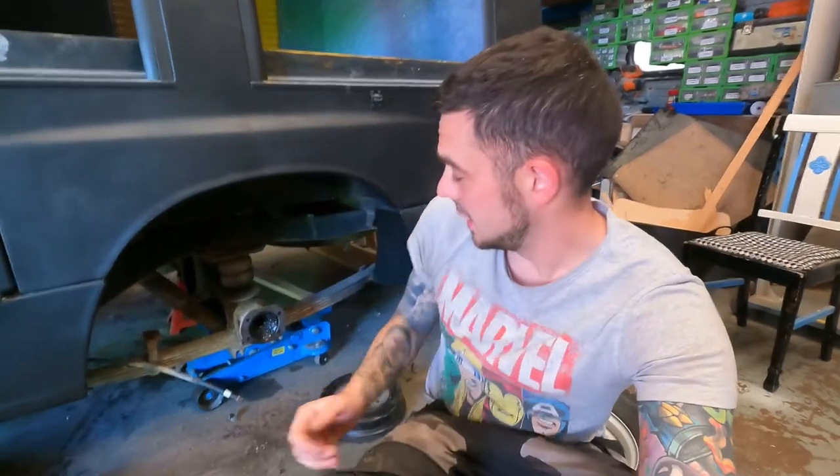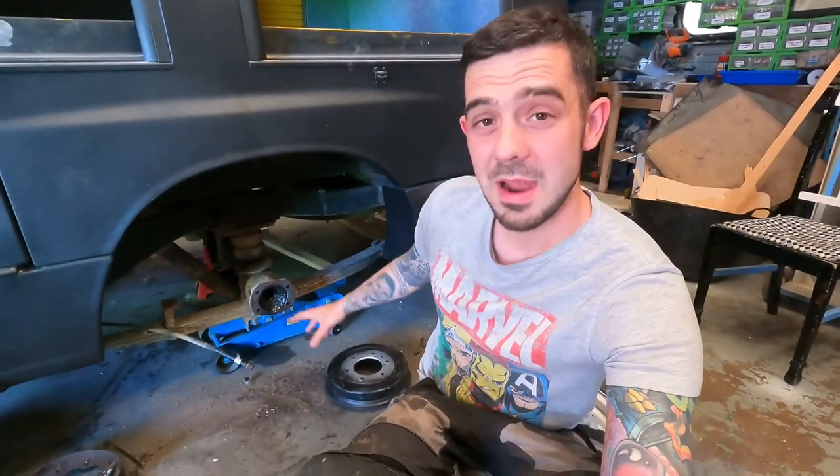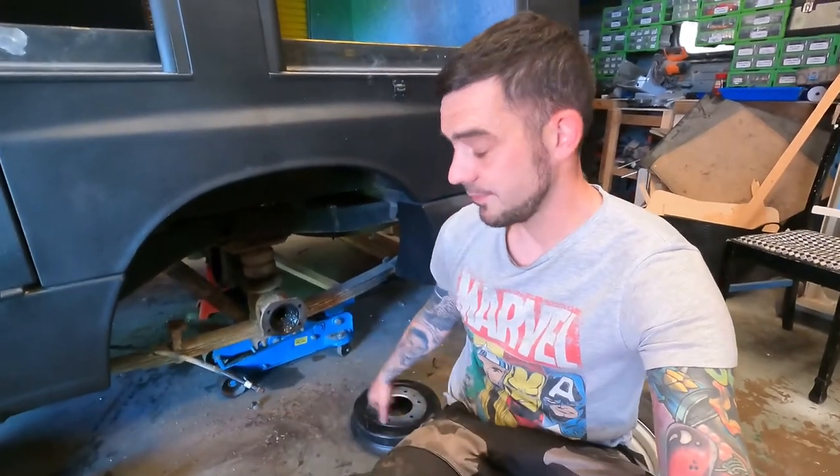As you can see, we've got no wheel bearing, no half shaft, just a brake drum. A friend has taken it away to tighten the wheel bearings up, and we're hoping that fixes the massive problem we have now. This is a Vauxhall Brava pickup truck that's no longer in production. Without the registration number, VIN number, or engine number, we're going to struggle to find the right parts. Other than ordering all three model variants and hoping one fits, we're struggling to find bits for it. We're hoping the wheel bearings can be tightened up to stop the wobbly wheel syndrome.